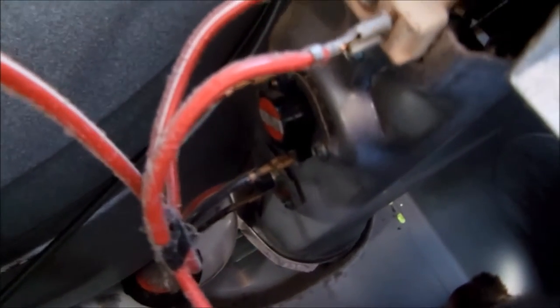So that thermal cutoff is still good. Next thing we're going to do is check this heat element — we can go right across it. It's probably a good idea to leave that disconnected so we can isolate the heat element. And this heat element is still good. So it's going to be a thermal cutoff inside here — in the back there's a thermostat and a thermal cutoff.